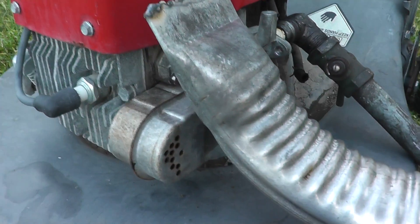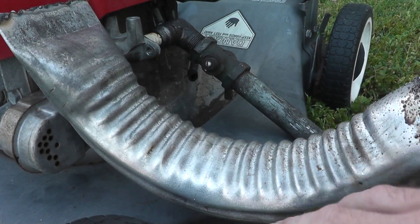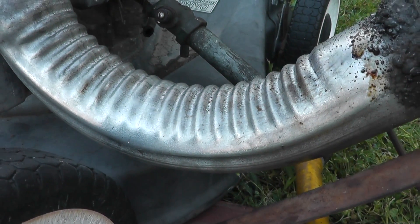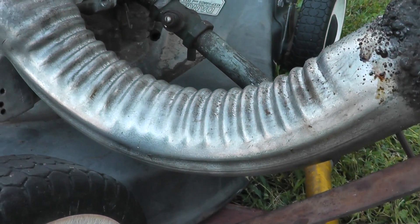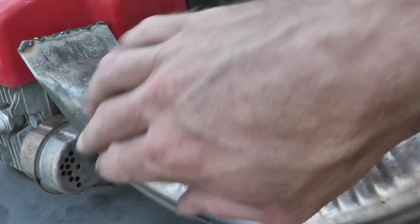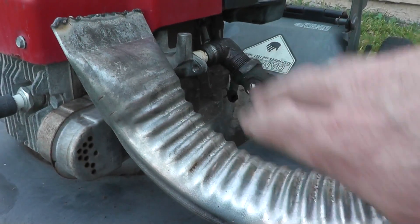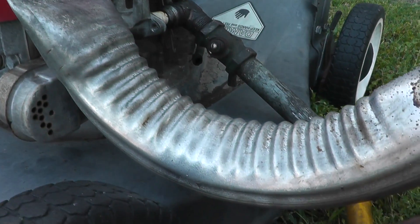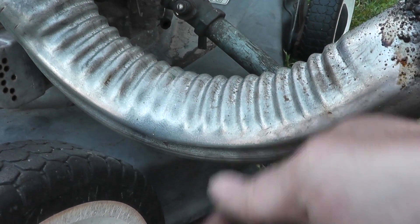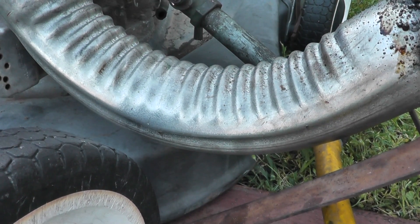You'll see I have it placed right here by the muffler. One of the critical aspects of this design is I need to keep this very hot to keep the oil at a temperature where it will break down and form a flammable gas. So I'm going to heat it up initially with a propane torch, and the engine running and putting hot gas through this muffler should continue to keep this at least moderately warm to help that oil break down. I might have to give it a little booster shot with a torch, but we'll just see what happens.